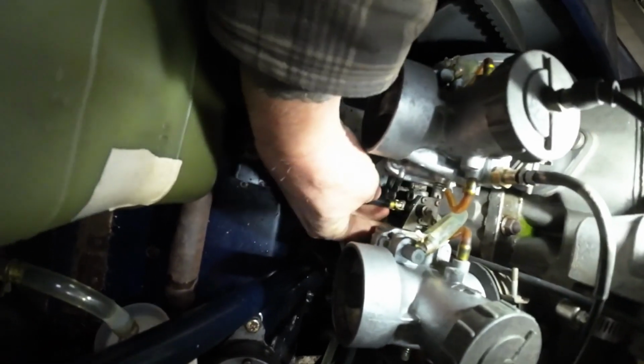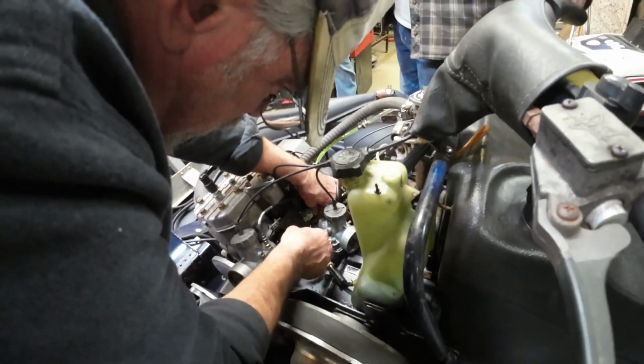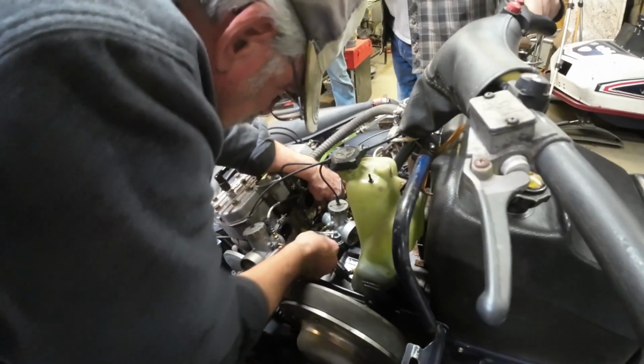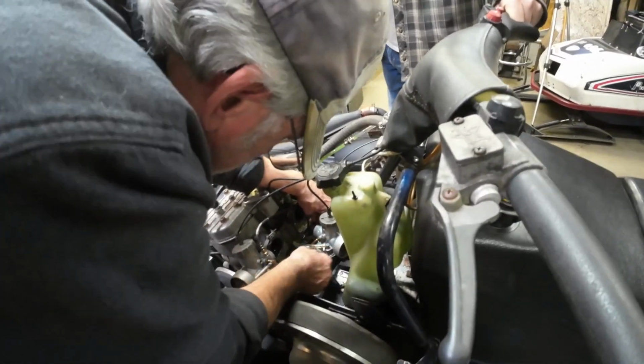That oil pump lever is pulling up tight in line with the cable. We'll get that fixed, and that's probably one more reason why it was a little boggy. It was only getting less than 3/4 throttle, and lots of oil. There's two marks on the oil pump. One is for idle, and one is for wide open throttle. The idle mark is at about 10 o'clock, and it should be at about noon. So we were getting plenty of oil.